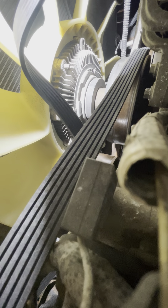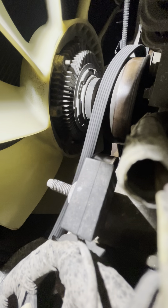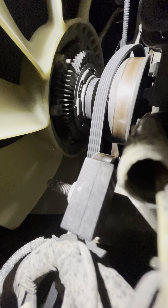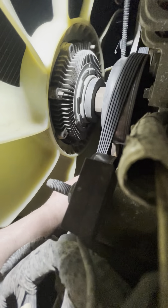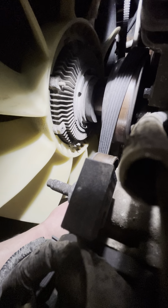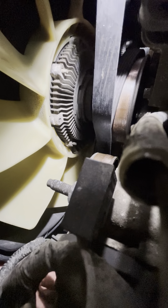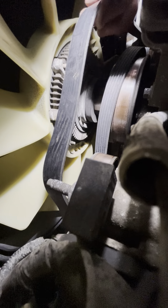This one is going to go on top of the alternator but we need to untwist the belt. Went around the water pump, and then this is what I forgot already — it goes underneath this one and around the power steering.